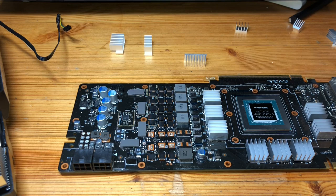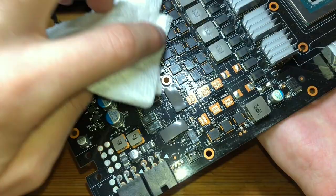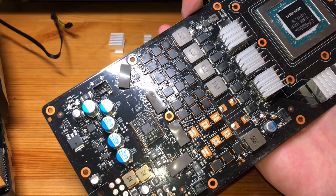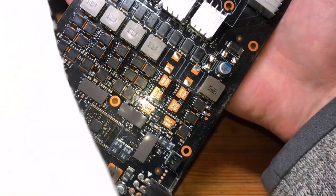So to start, we're just going to simply take a piece of cloth, or a lint-free cloth, or a paper towel, and just start by very carefully wiping away. You can see some of that residue there that we saw in the other chips. So we're just going to start off by first doing a very gentle pass. Cool. And then after having done that, we'll take our handy dandy eraser again. Use that as a second pass to really buff these modules. All right. And then once more over with our handy dandy paper towel.